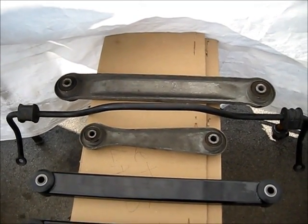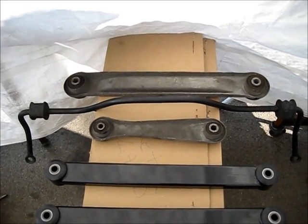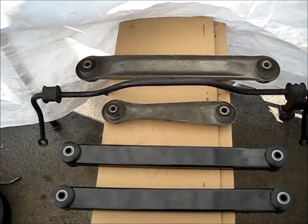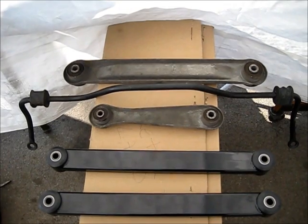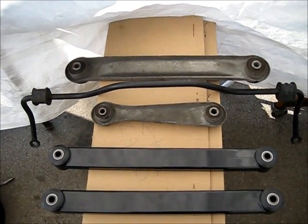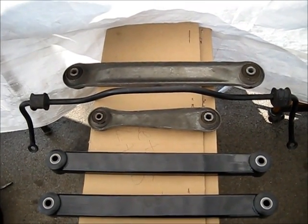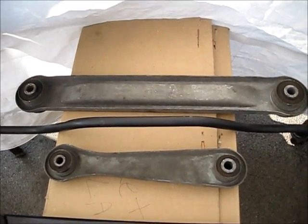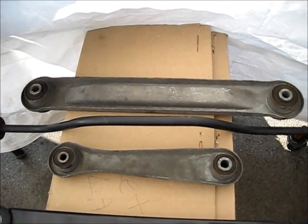Movement equates to losing control of a vehicle in the suspension under extreme conditions. You can see how skinny the sway bar is on the back — the reach is about 18 inches, so that sway bar is not adequate in our opinion for the job that these vehicles are expected to do. They're driven very hard in extreme conditions sometimes and they deserve the best componentry available. You start off with a press steel track arm with rubber bushings — very flexible, not adequate in our opinion.